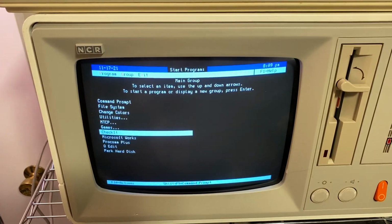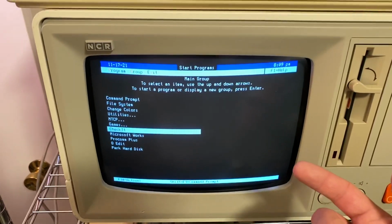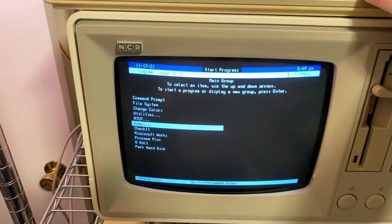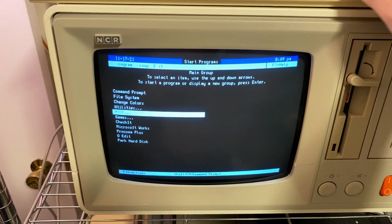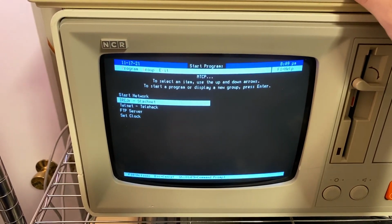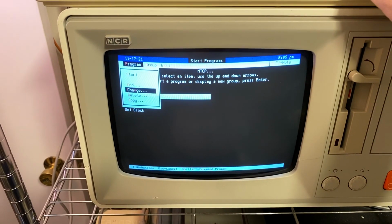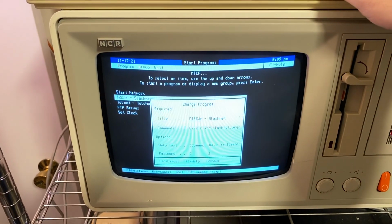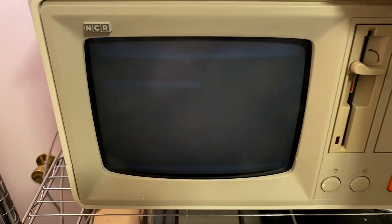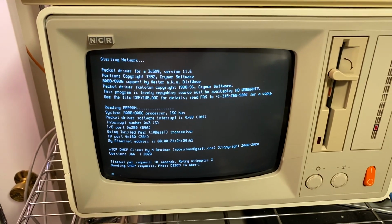On this system, I'm running MS-DOS 4.01. And this is actually the MS-DOS 4 version of DOS Shell, which I'd never really seen before. It's very different than the one that comes with DOS 5. You're kind of intended to set up these program groups. Everything is accessed by pushing F10 and then going into this menu, and you can add and change entries. Then you can launch a program or batch file. So it works okay, but it's a little tedious to set it up.